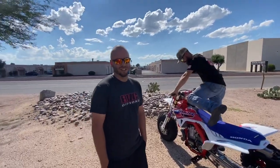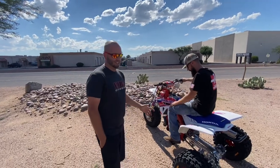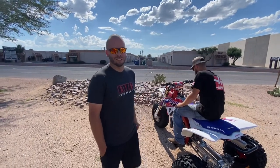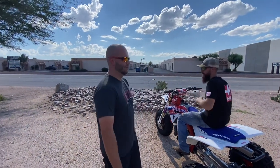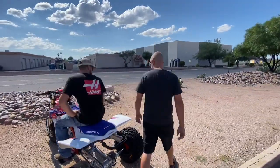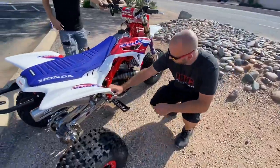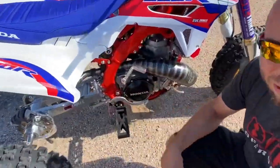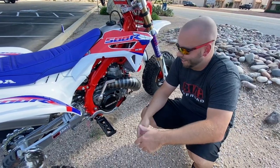Starting these things is all technique. You got your timing right, you got your motor right, everything's sound. Other than that, it's technique. You gotta get it to top, a little bit past top, and give that thing a full kick with your heel. This is a shorty kicker, so if you come around here. I definitely recommend this kicker. If you guys ever watch Happy Gilmore, shout out to Matt Seeger, he said it looked like the stick from Happy Gilmore. It kind of does.